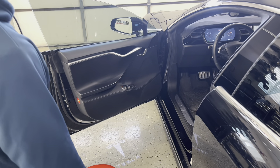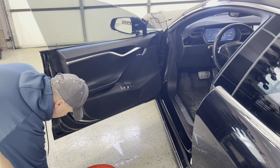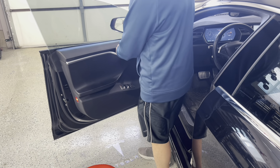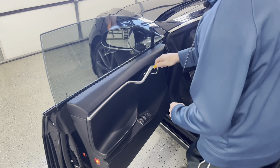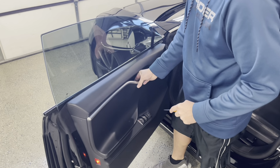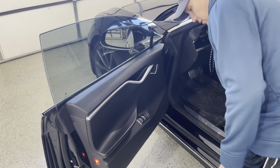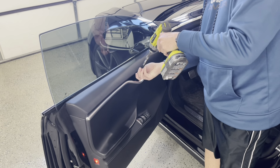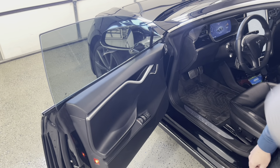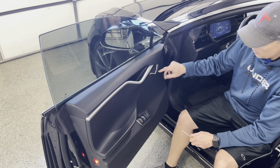I've done two of these so I can do this confidently, but I have to pick my son up from school in about an hour and 30 minutes, so I'm going to bang this out as fast as I can. It may not be the best camera angles, but I'll walk you through the process. Learn to do this yourself — don't rely on Tesla. First step: remove the door panel. Get a pry tool and there's a little rubber pad over the bolt on the inside of the door handle. Pry it up to reveal a 10 millimeter bolt — sometimes easier to use a drill.